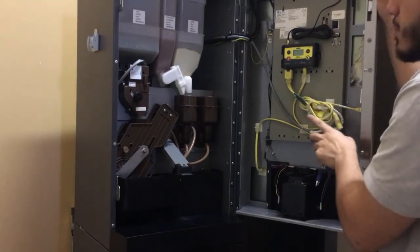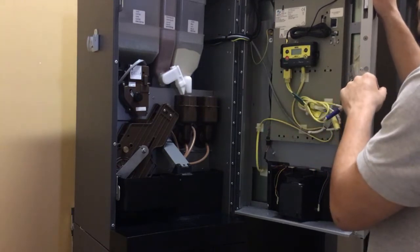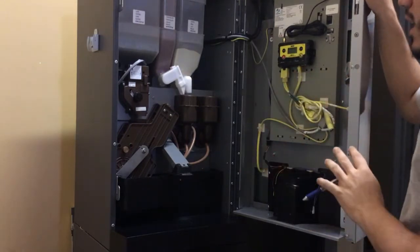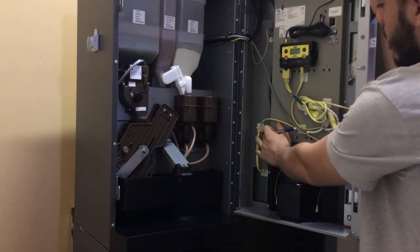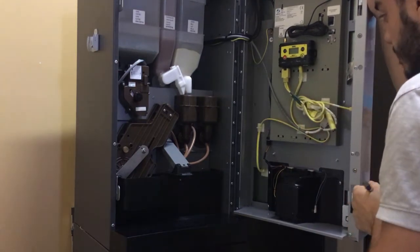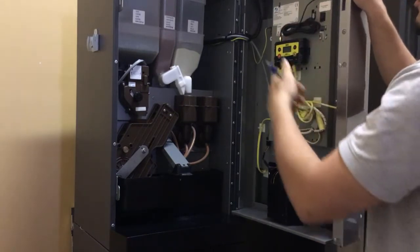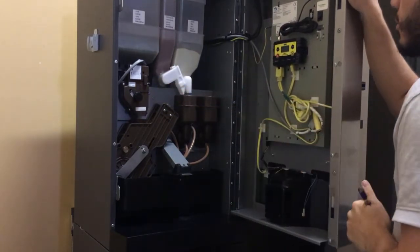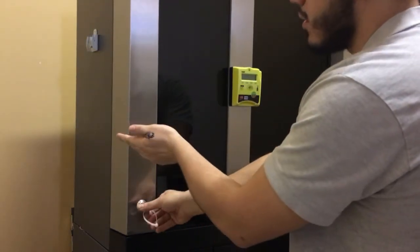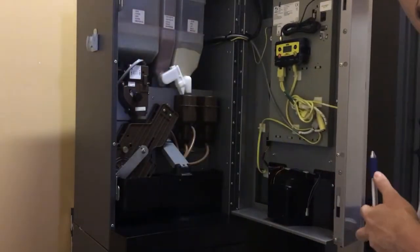When it comes to cable management, I suggest that you keep it simple, easy for you to understand. You can compact it a little bit and make sure it doesn't become loose at any time. That is why I used tie wraps on the mounting bases. Try to keep it very close to the door, so you don't touch any of the compartments on the machine. For example, this setup here is not gonna touch the back. You can tell it's close and fine.